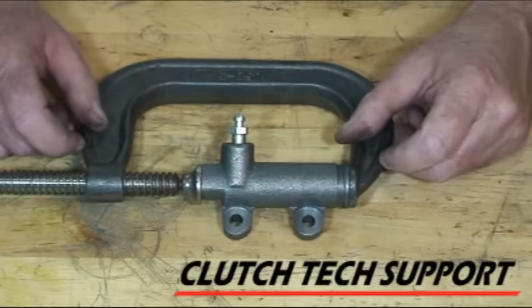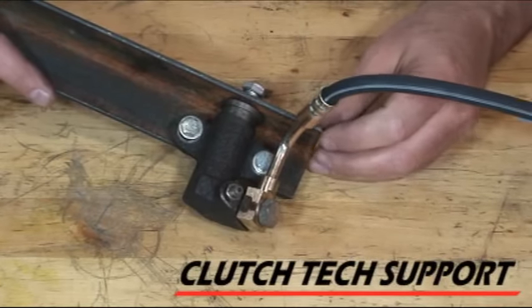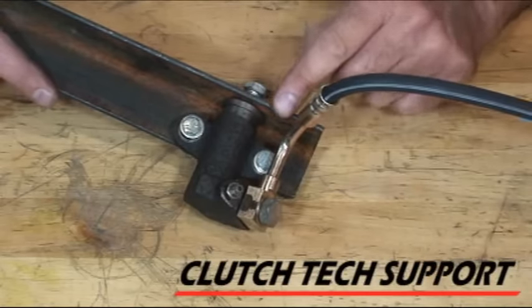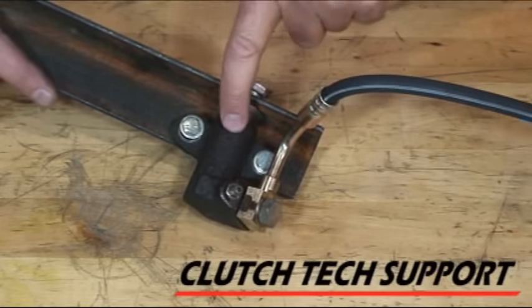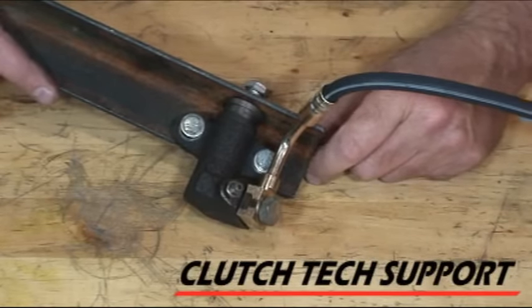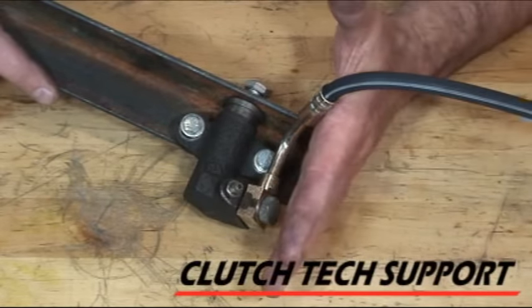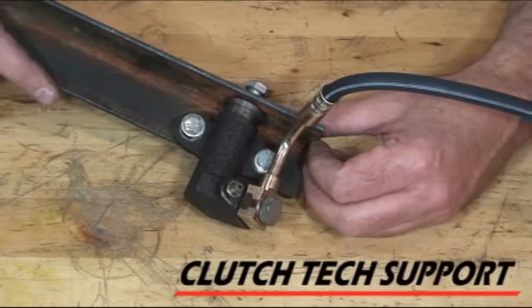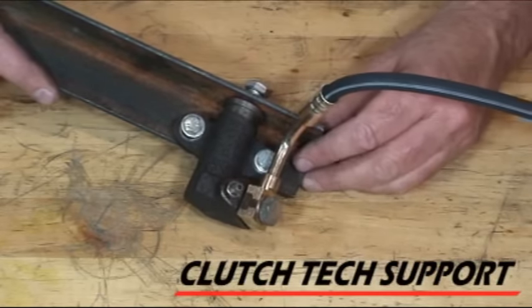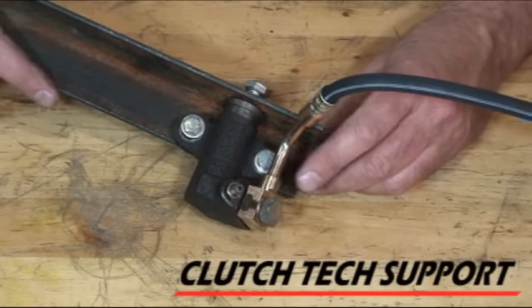Some systems won't allow you to block it with a C-clamp. Just to illustrate the simplicity of the concept: with a short slave cylinder, we've actually got a bolt sticking in here blocking the piston, with a couple of bolts going through and clamping it to a piece of angle iron. There's our bleed screw. Push on the pedal, create some pressure, hold, open the bleed screw. The slave cylinder doesn't move, but the clutch pedal goes to the floor.